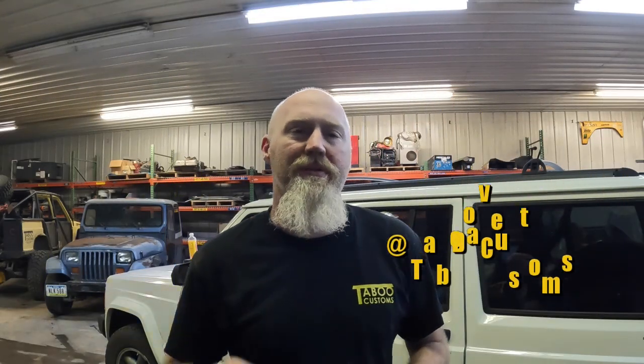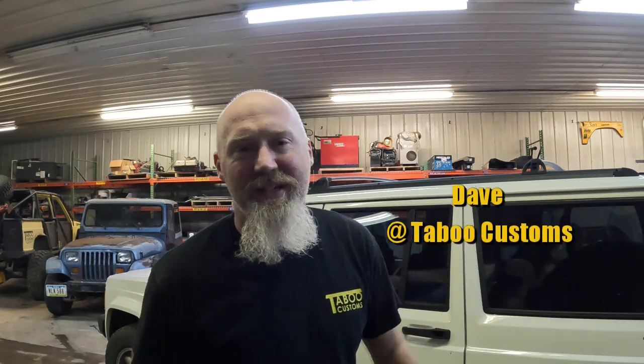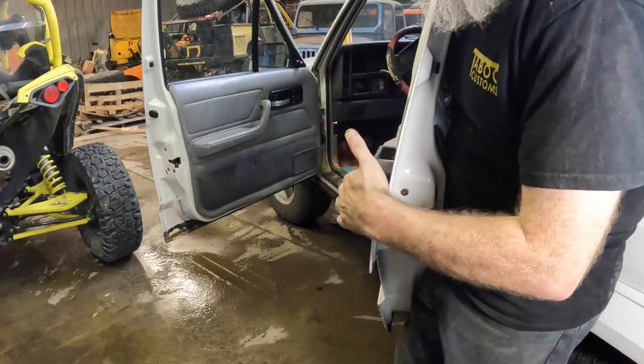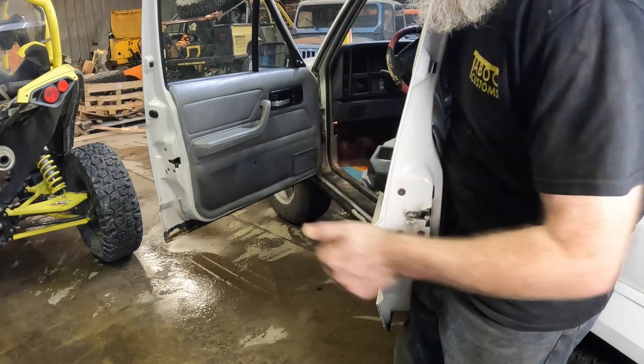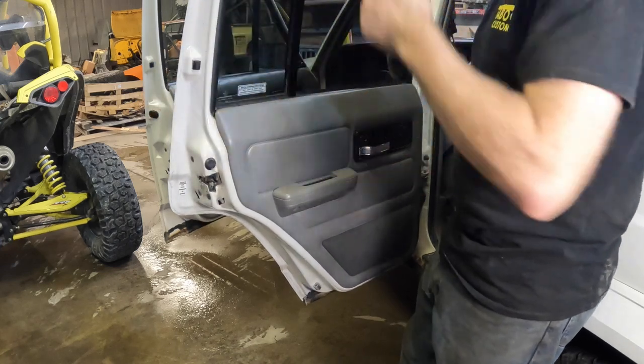Dave with Taboo Customs. Today, in this video, we're going to be swapping out a door handle on this '96 Cherokee behind me with a new one off of a donor Jeep. So let's get started. The reason for this, and it might be what happened to yours, is the button that you push from the outside is basically pushed into the door. It got overextended. So we're going to be replacing that.